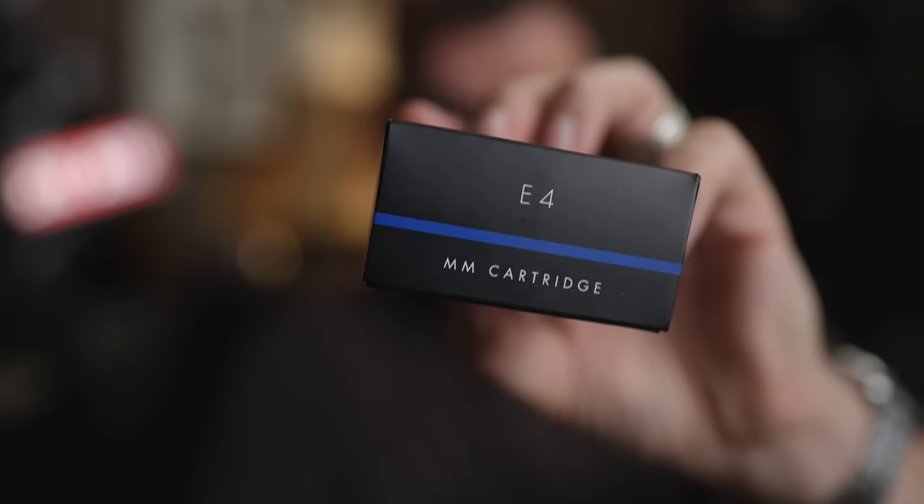I'm really impressed with the E4. So the takeaway here is: if you already have a turntable or you're looking to get into vinyl and want a really good experience, you can get a table from Fluance, U-Turn, Michel, or even Audio-Technica. But what I would do is save up, get the E4, have fun with it, and then save up and get the Pro-Ject Tubebox S2 — that combo together comes in at $900. These two products — the Tubebox S2 and the E4 — play a more significant role in the sound than the actual turntable does. Whatever Michel is doing with isolation, Sorbothane feet, perfect leveling — it's spectacular. And if you're looking to buy something from a family-run UK company that most people won't have, consider the Technodeck.